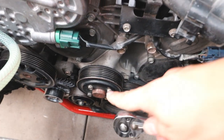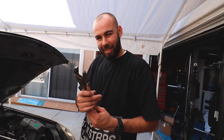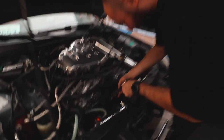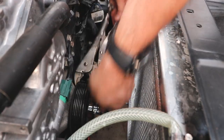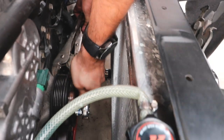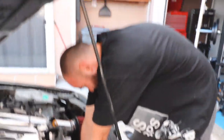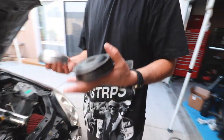The first one I'm removing is the water pump pulley, held on by literally four screws, so it won't be too hard. We're using vice grips - putting them on here and getting a good angle. You put the vice grips on at the right orientation so you can bring your hand down on them to get leverage.